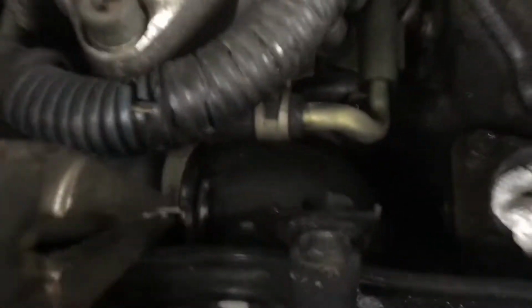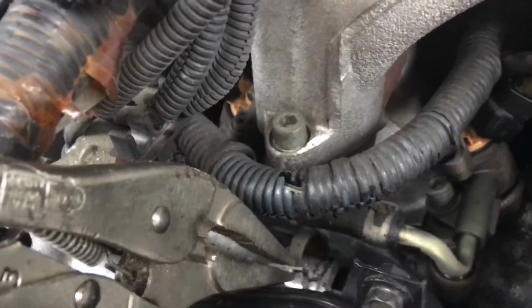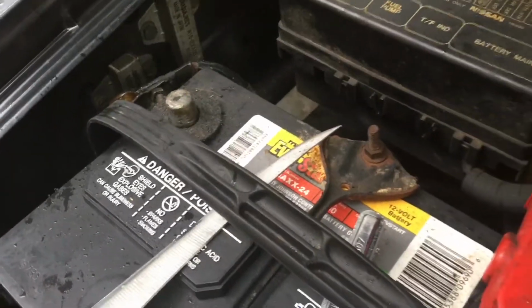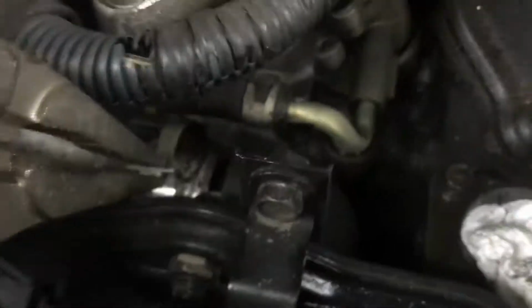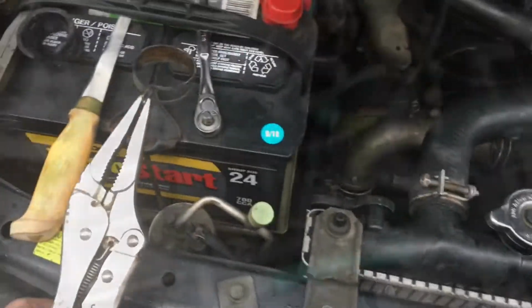So work smarter, not harder. I'm going to go ahead and cut this hose. My vice grip is holding the clamp open, and I'm using my fishing fillet knife, an old one I had sitting around, to cut a line straight across, as you can see right here. Then I used a long pair of needle nose pliers to fish it out of there. So it's fairly clean. Place your clamp off to the side. Be careful unclamping it. It's under pressure.